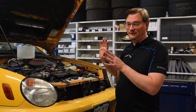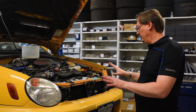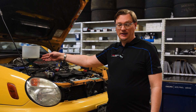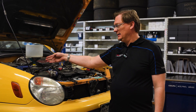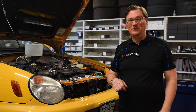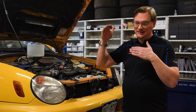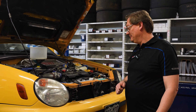The car's off now. The fans cycled probably three times and the coolant level grew and fell, so now we're just going to let everything cool off. Keep an eye on the level in the no-spill funnel, wait for the engine to cool down — give it about an hour — make sure the auxiliary tank is still full, then put the radiator cap on. The key takeaways: use a no-spill funnel, watch for air bubbles coming out, and make sure there's coolant in the overflow tank. It's boring to wait for the fans to come on, but it's got to be done.